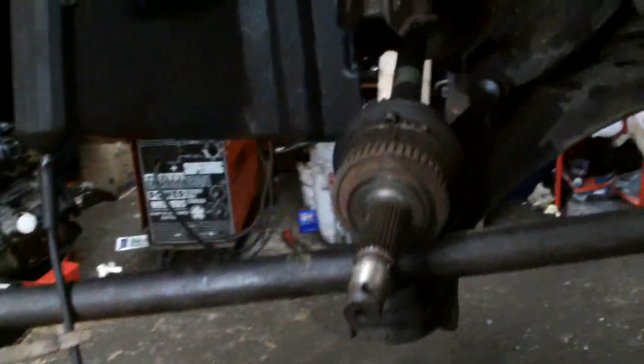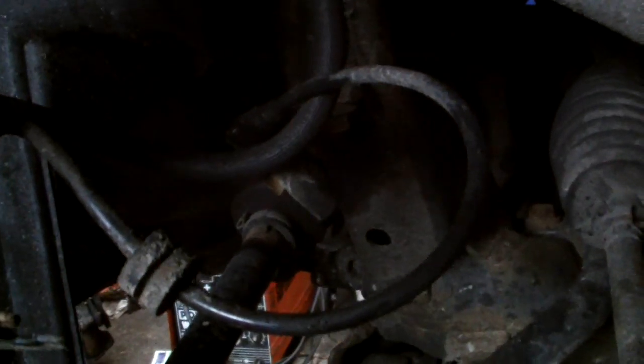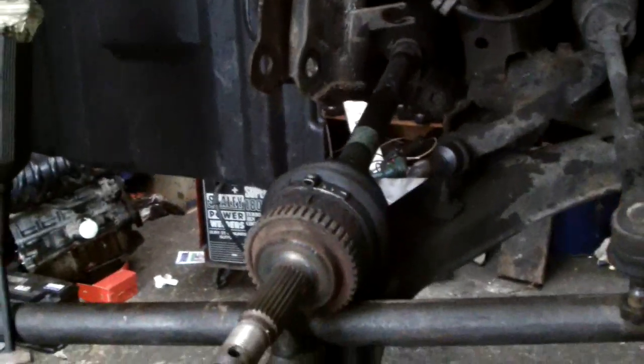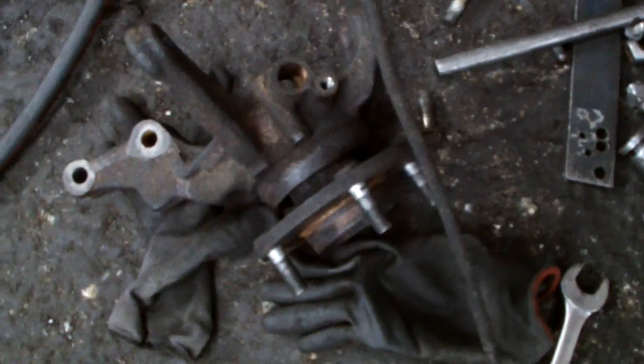So there we have our unit, and next step we'll be bolting back the other again. We'll hook it around here first, onto the shock, into the drive, onto the knuckle at last here, the tie rod. And then we'll not forget to connect the ABS wire, and then the brake caliper. So that's our next step — we'll put everything on, then we'll bolt the other way up. And that's our next step on our Nissan wheel bearing.